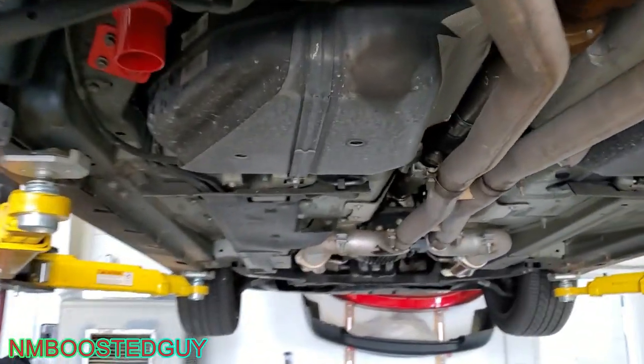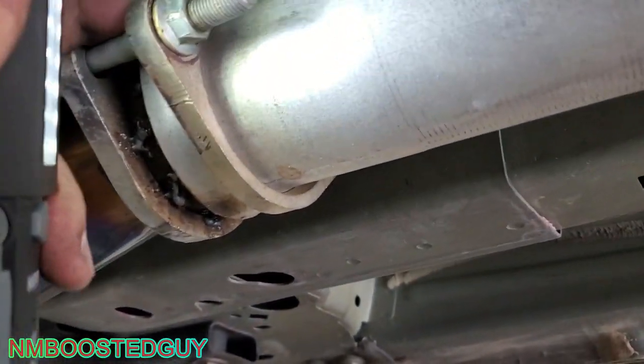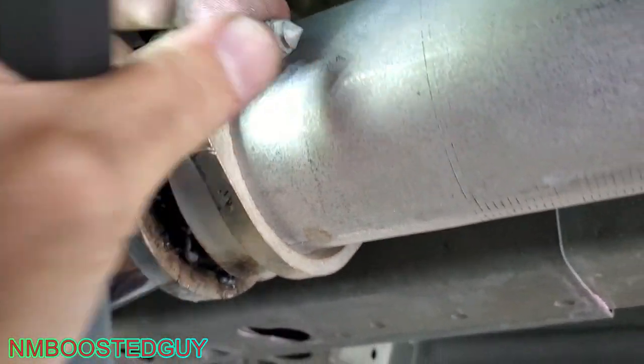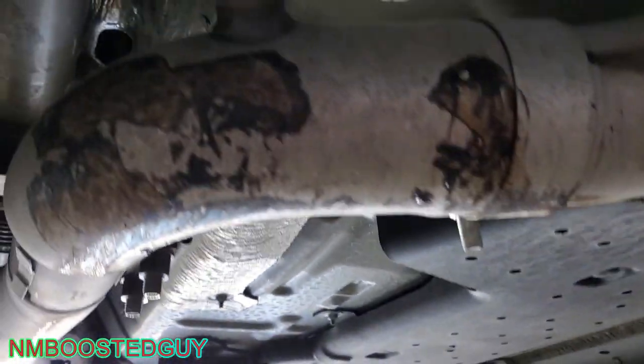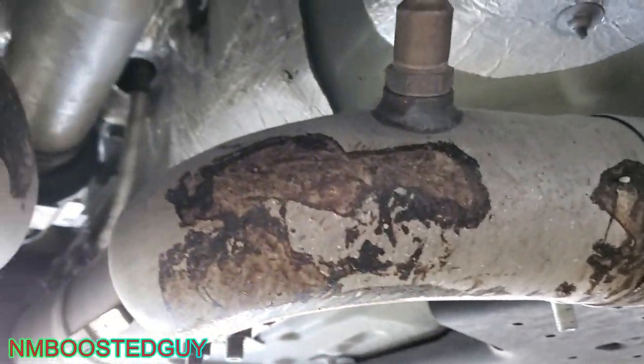And this also gives me a chance to go through and check some of my exhaust hardware, because this stuff tends to get loose. Put some good Loctite on there last time. It's still, so I can move it with my fingers. Hear that? So it's a little loose. Just crank down on them a little bit. So I had a plastic bag get stuck to my exhaust a couple weeks ago. It's been burning off. Stinks. But all right, we'll be back once I am out of here.